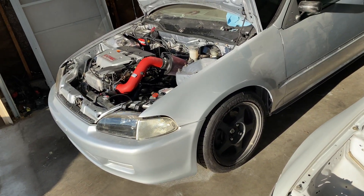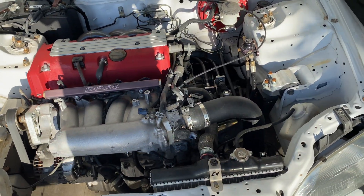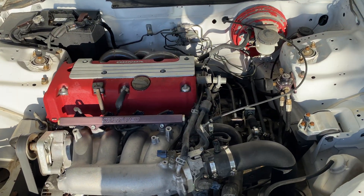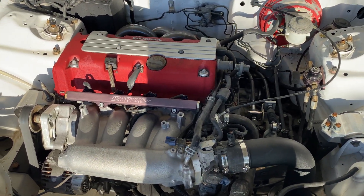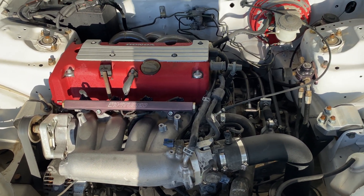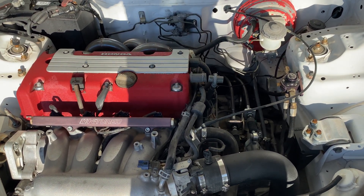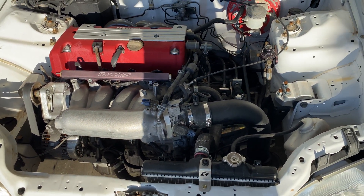So to summarize: the A2 has 200 horsepower with a 4.4 final drive, and the Z1 has 210 horsepower with a 4.7 final drive. Where things get different is the actual harnesses. The 2002 to 2004 is all bolt-on. Companies like Wireworks were probably the first to make conversion harnesses for these. As I've shown in other videos, you can run a 2002-2004 conversion harness on the 2005-2006, but only if you're running the 2005-2006 ECU with the 2005-2006 harness — you can't swap back unless you use a jumper harness.